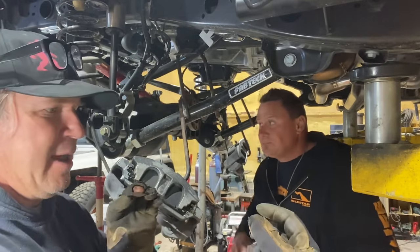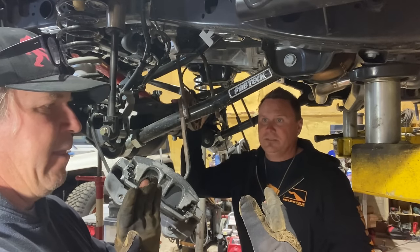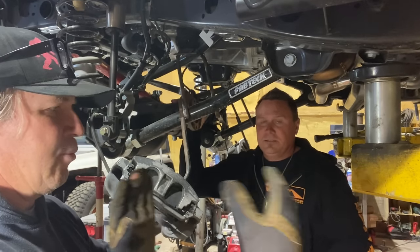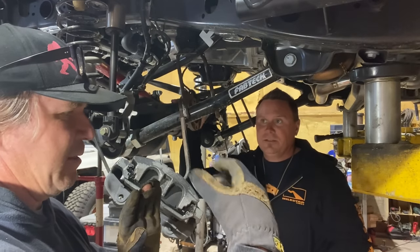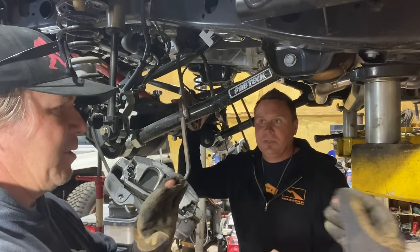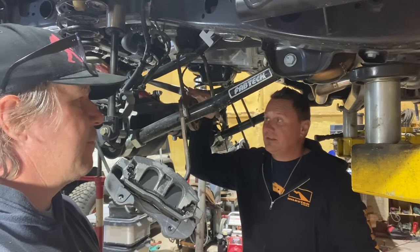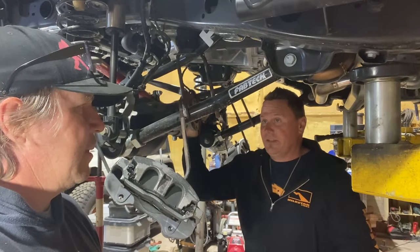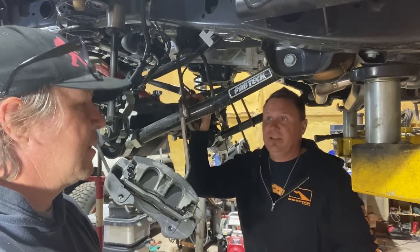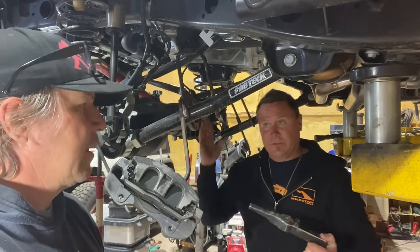So the pinion has two bearings. It has an inner bearing and an outer bearing. Correct. And you want the preload so that it rolls at the perfect amount of resistance, but also the depth. So we're gonna go into pinion depth. The pinion depth on these is set behind the inner pinion bearing. It's the shim thickness. And that's what's gonna set our ring gear pattern that you'll hear a lot about if you're doing this kind of stuff.